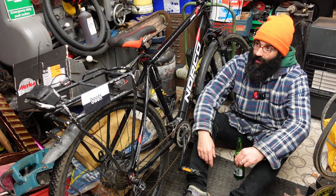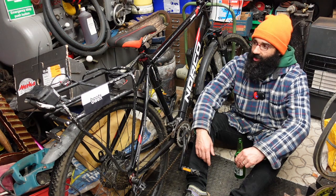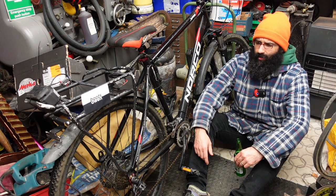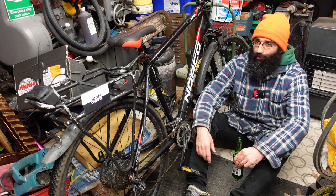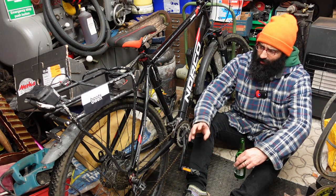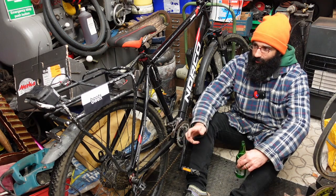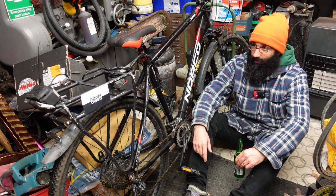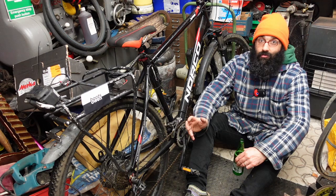I'll just show you a little bit about it today. After a few months I got the bicycle end of it working initially and then just didn't really want it as a power assist, so I've left it in the shed. But today I took a notion that I could do something about it. I've been trying to fix the Profit e-bike, featured in other videos, and I made a long video about trying to get the circuit board going and soldering — I didn't fix it in the end. But I thought if that project's gone to rest I'll have a battery spare, so I could resurrect this one. All the parts actually were working except the battery, which is kind of cool, so I've put a little 40 volt drill battery on it to power a 36 volt controller and it works.